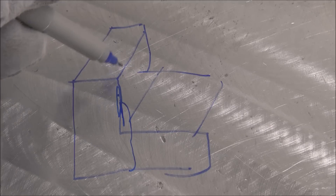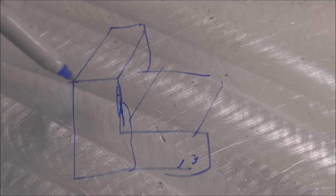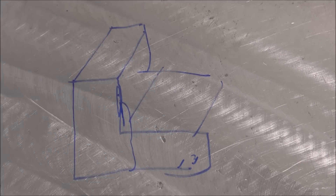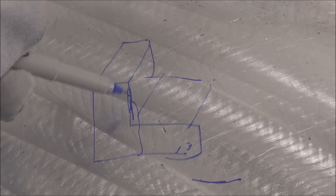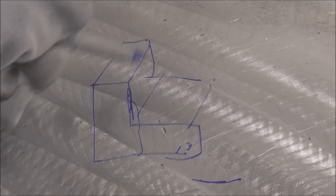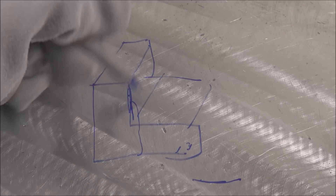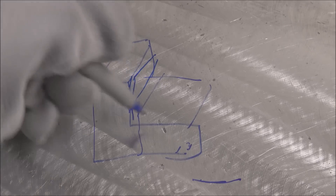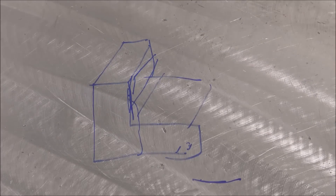So I'd recommend getting in there and stitch welding everything you possibly can, and make sure you use thick enough material. I made that tank about 10 years ago out of 1/8 or 3/16, which was a pretty big mistake — I should have done a quarter inch so there wasn't any flexing. You could also do some gusseting on the inside to stiffen it up, and put baffles throughout so the fuel isn't sloshing all the way to the sides while driving.